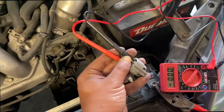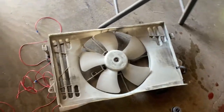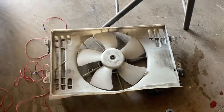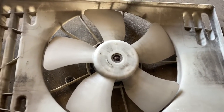If I do get voltage, then you know it's the motor. Looks like the fan motor is not working — I gotta hit it for it to turn on. So that's the reason why it's overheating. I'm going to see if I can upgrade the fan and go from there.